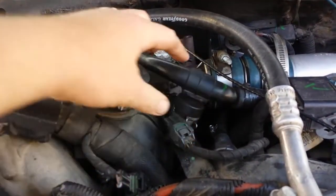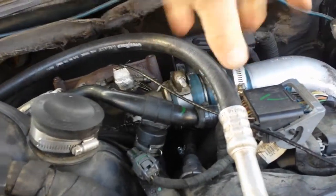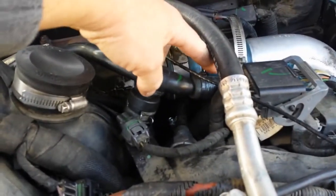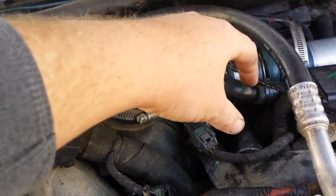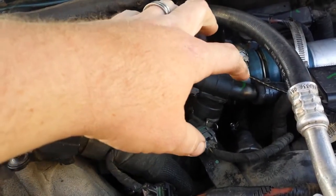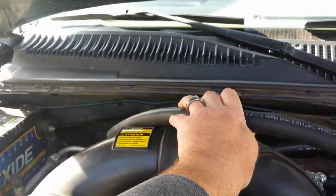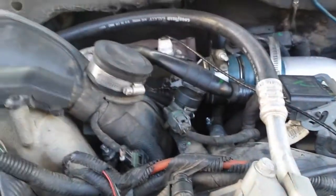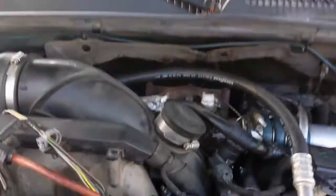What's popular to do is to reroute the PCV. You can cut it off here, or you can get a kit that just replaces the little connector down here. What I did was just cut off the plastic tube where it's round down here and where it's round back over here. Then you can hook up three-quarter inch heater hose, run it wherever you want, and drop it down — one on each side.